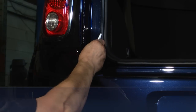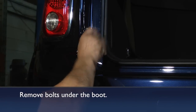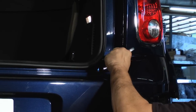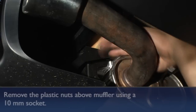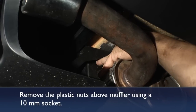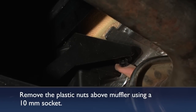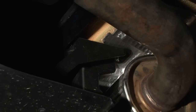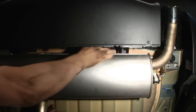Next, take the screws out in the opening where the rear hatch is and down the lower corner on each side. Then reach up underneath the car to get at the fasteners that hold the plastic brackets for the bumper cover — those are hard to get to. They're above the muffler: two on each side, one high and one a little lower. You'll need tight-quarters tools and a 10 millimeter socket.